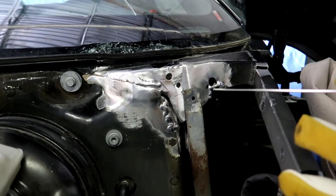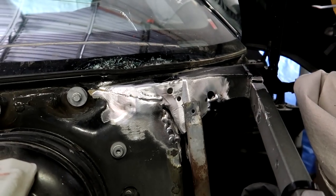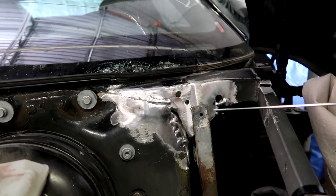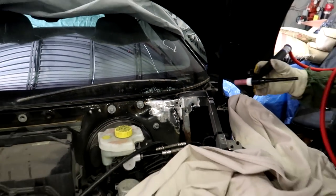Sides here. I'm gonna just bridge it. Okay. Go ahead and fill it up as much as I can. Set some heat in there. I'm gonna go on the back side, put a little more weld, and we're gonna come in here, grind it down as flat, and we're gonna put the pad back on there. Okay. Weld it up, and that should be good. Perfect.